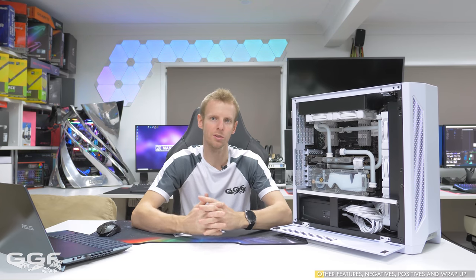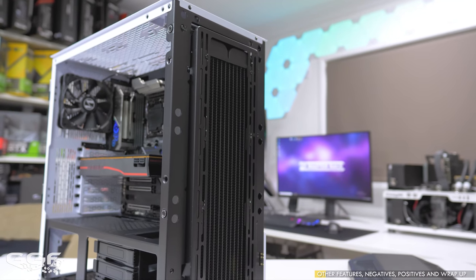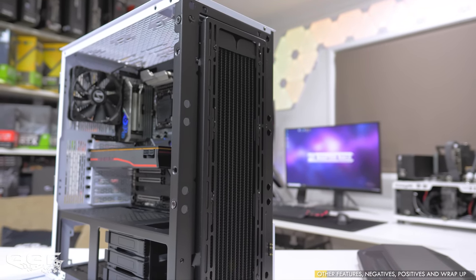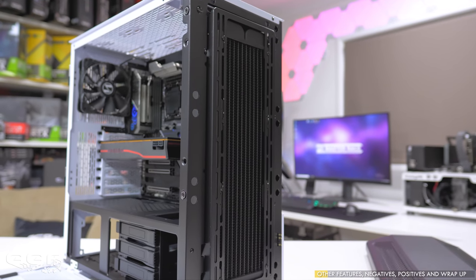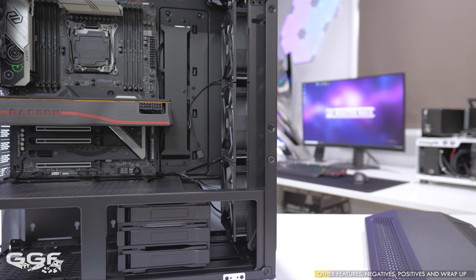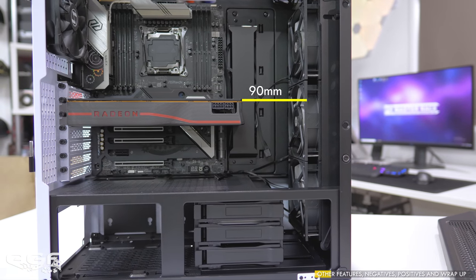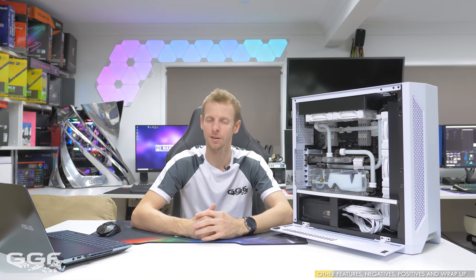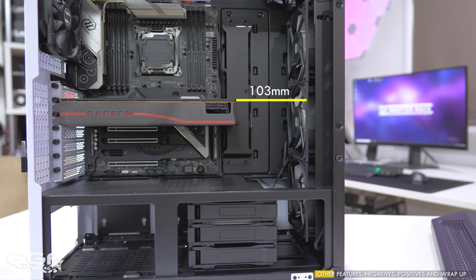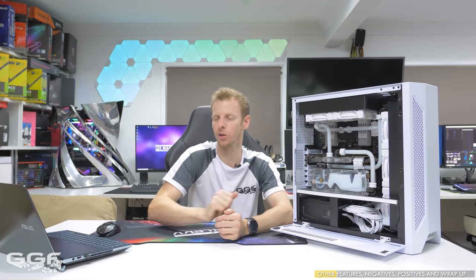I've designed some options to show what you can do with thinner or smaller radiators, especially at the front. Say you're using a standard GPU like a 5700 XT — that's 270mm long. If you go with a 40mm thick radiator at the front with the bracket pushed all the way to the front, you have roughly 90mm for a reservoir or pump combo. If you go with a slim 28mm thick radiator, you'll have 103mm for a reservoir and pump combo. So that gives you some flexibility, but don't think the build will look like mine — it is very tight on space.